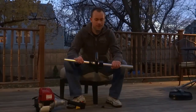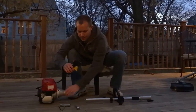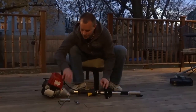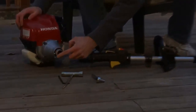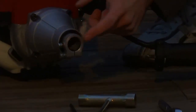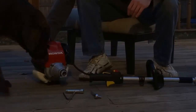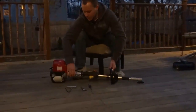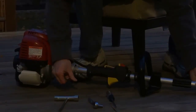Now that I have the coupling, spacer, handle, and loop for the harness, I'm going to put the throttle trigger on and slide it onto the tube. On the Honda engine there is a bolt to tighten the surrounding area to compress on the upper drive shaft, but there's also a screw to center the drive shaft. Since the Stihl combi upper drive shaft does not have an eyelet hole to center it in the engine, I'm removing this screw as it's not necessary. I'm going to insert the shaft into the upper drive shaft tube assembly. Once fully inserted, tighten up the hex screw to secure it around the drive shaft.